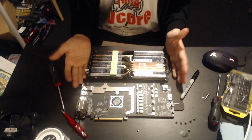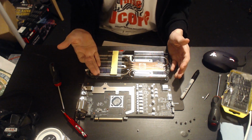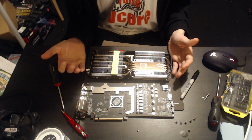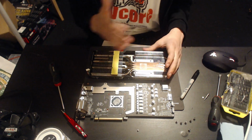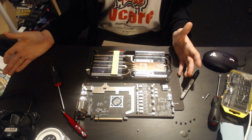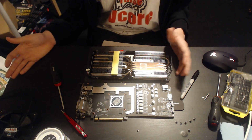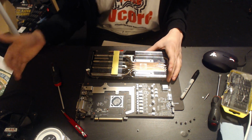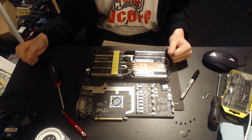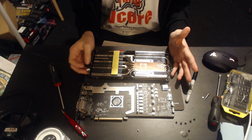you don't care about noise. You're going to slam that fan speed, and this heatsink at 100% fan speed just does not deliver a lot of performance. It's fine at up to like 50%, but at 100% fan speed, the performance is not that much better. It doesn't really improve. You get stuck in relatively high temperatures very early. So I need to test that.